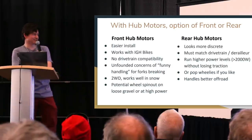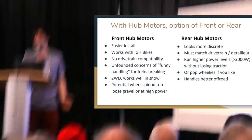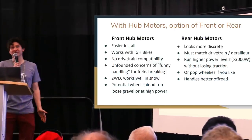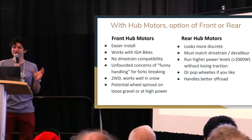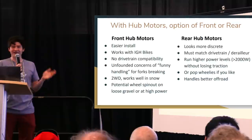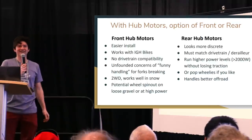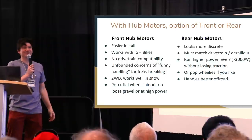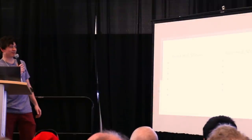It's a bit of a different situation than with loose dirt. To the rear hub motor's credit, it looks more discreet — you can see the motor on the front of a bicycle more clearly, whereas a rear motor is tucked between the disc on one side and the cassette on the other, and if you have pannier bags, it's largely hidden. For people interested in keeping the bike looking as non-electric as possible, a rear motor is the preferable option.